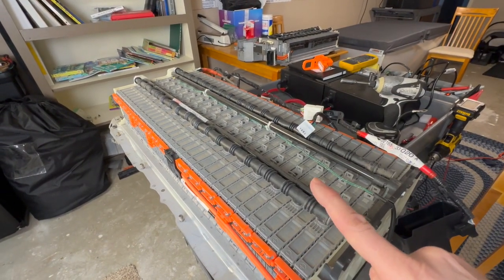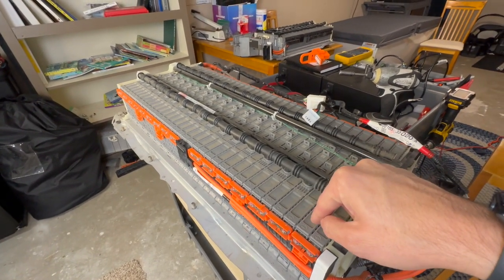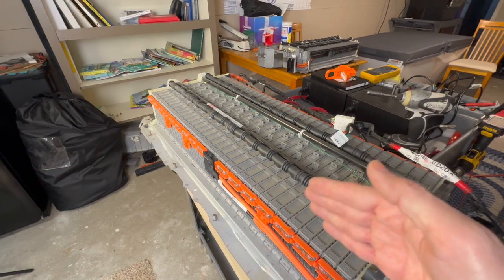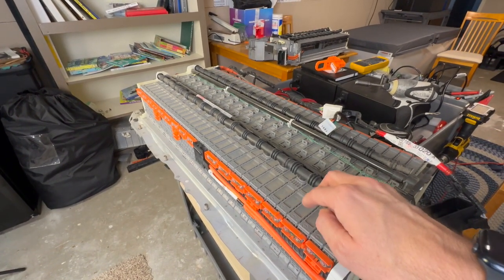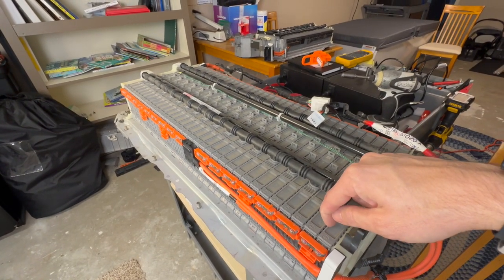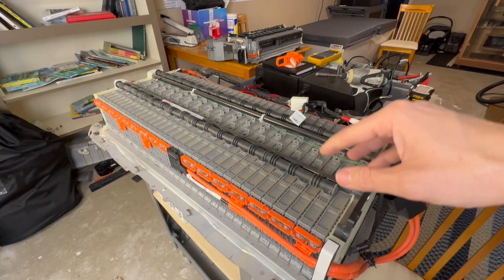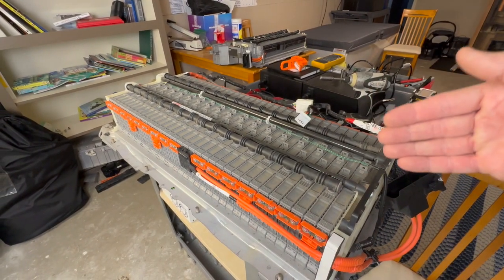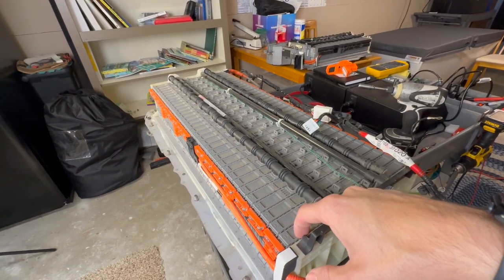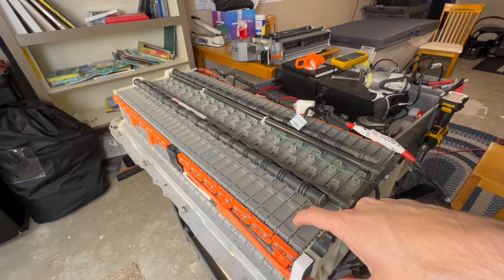What you need to know is if you have high voltage drop, don't necessarily discard that module, but do some other forms of testing. If you have 28 modules or 34 modules that all have 1 volt of voltage drop or less, they can probably still all work. You're going to, of course, want to compare notes with how well the internal resistance readings are after you do those tests as well. But they aren't necessarily bad. They may just not perform exactly the way that you want them to. So what I like to look for is low internal resistance, low voltage drop, and those are my 2 main big things. And of course, resting voltage as well.